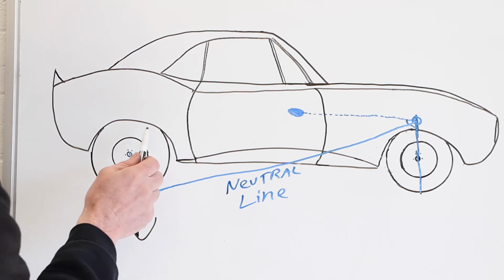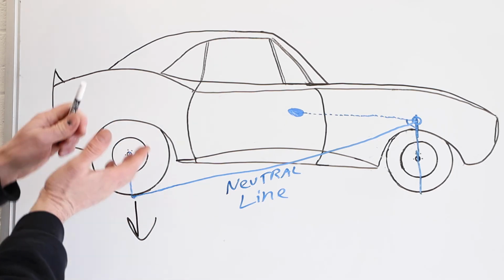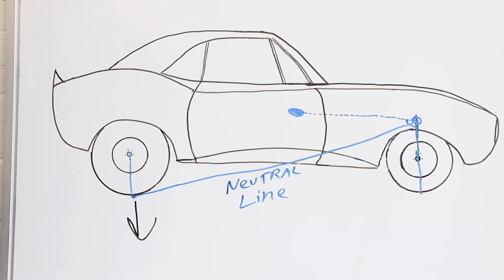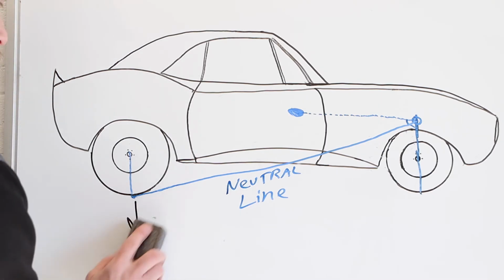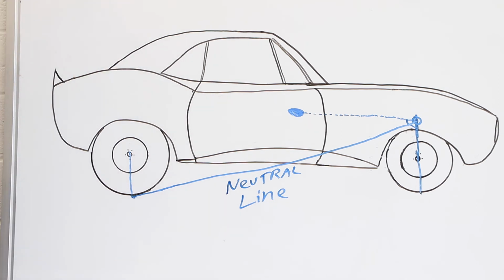Now remember, we do have moving suspension here. We have shocks, the ladder bar system moves, everything's moving. Since we have more torque available to plant that tire, under a ladder bar we would plant it too hard and maybe even rebound and unload the rear end and lose traction. Under a 4-link setup, we can control much better that application of torque to the ground.